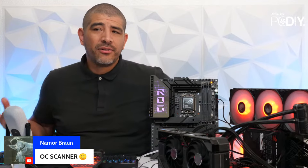In terms of what you're talking about from frequency, frequency is pretty much dependent on the GPU, right? Different GPUs are going to hit different targets. And then there are other factors you have to account for, like some graphics cards, for instance, our TUF Gaming graphics card could have a default TGP that could be different than the ROG Strix graphics card. The ROG Strix might have a higher TGP. So because it has a higher TGP, it also boosts higher, has a higher clock frequency envelope, right? And that's even independent of your overall overclocking margin that is variable from one GPU to another, right? You can't really speak in absolute terms, as if you can just arbitrarily hit one value across all GPUs.